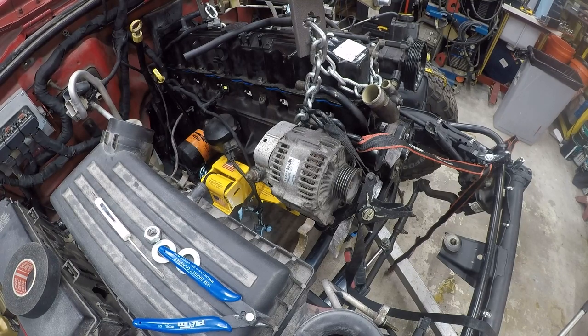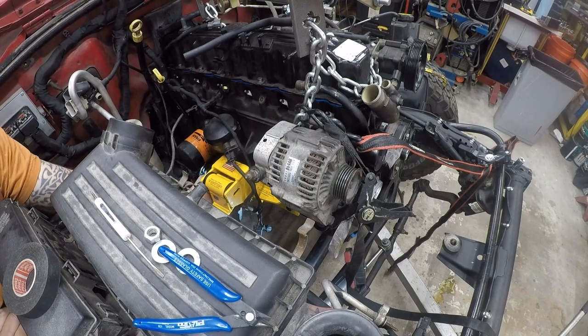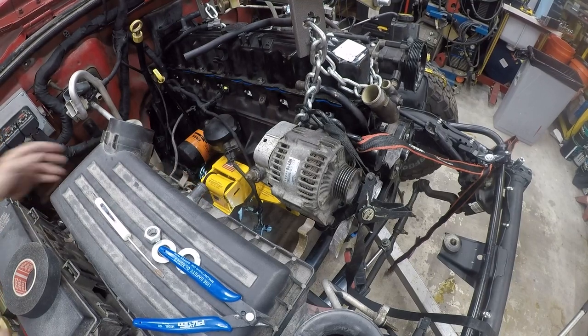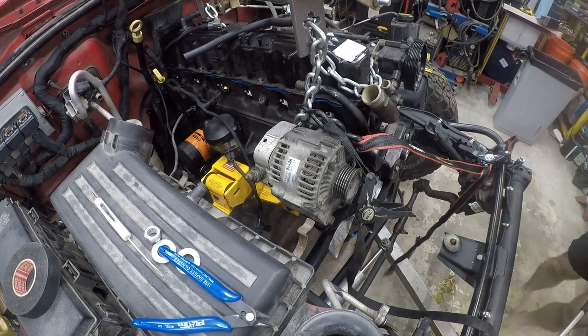I really think backing it up. So I actually think this is kind of the direction to go. Cut a scab, a 3/16 material, bolt here, a bolt here, and cut a hole there. And so it's up 3/16 of an inch. And I actually think that's the simplest, easiest solution to this problem, as scab a piece of 3/16 in to support it and move it out 2 inches and call it a day. But I'm going to message Brown Dog and see what he has to say, see if there's any wisdom from the trenches.